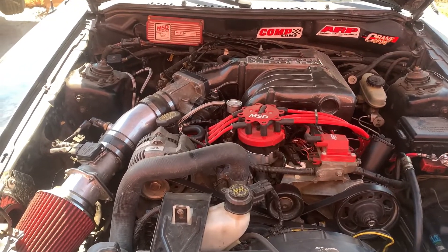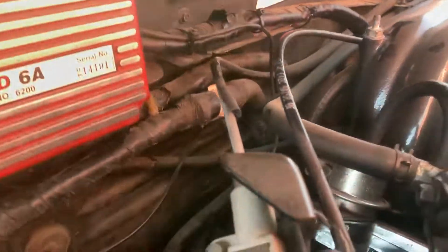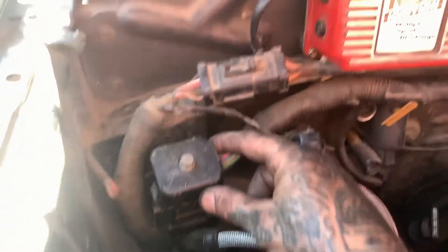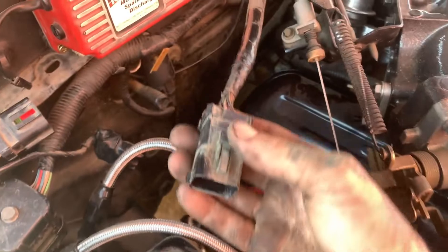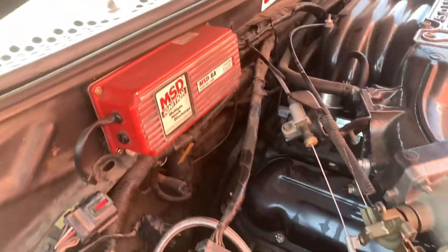Moving back up to the motor for finishing out the trans harness, come again to the passenger side. You'll see how it runs up here and it's normally held in on a clip — you can just mount that clip off and bend it, you won't need it since you'll be switching for a new trans harness. It runs to the farthest part of the passenger firewall where you have a big one which is the engine harness, and this one which is your trans harness. Push that tab in and pull out — your automatic AODE transmission harness is now disconnected. You can route it out to get it out of the way, or wait until you get the transmission out and it'll come down with it.